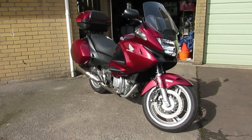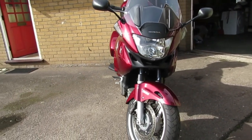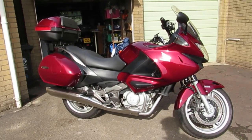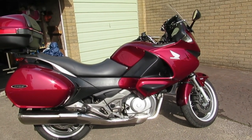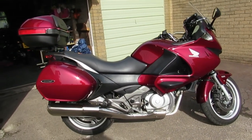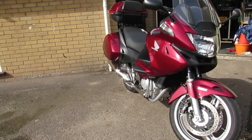Okay everybody, thanks for watching. Here is my NT700, which has been misbehaving recently. When driving along at relatively low speeds, she's developing a bucking bronco type effect — the power is dropping out and then surging on in about a one or two second cycle. I've investigated this and it's suggested that it's the throttle position sensor, and I've already eliminated the well-known problem with spark plug caps. I've replaced the spark plug caps and the leads, so I'm fairly sure it's something to do with the wiring harness and the sensors. Let's get her into the garage and start investigating.